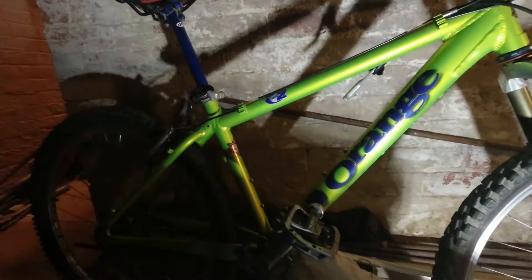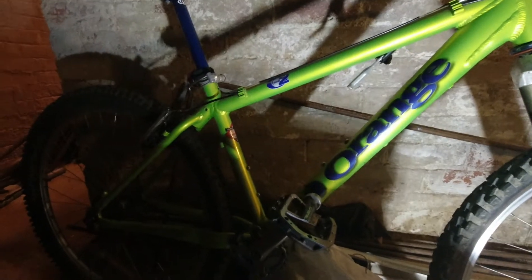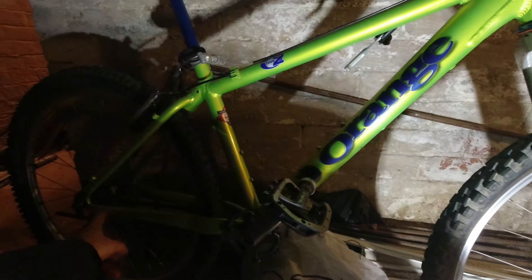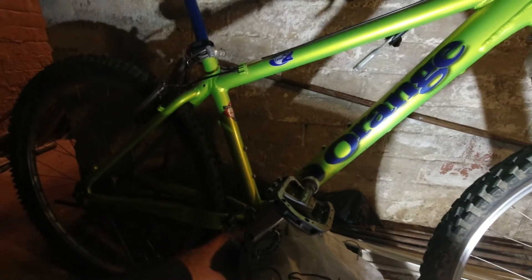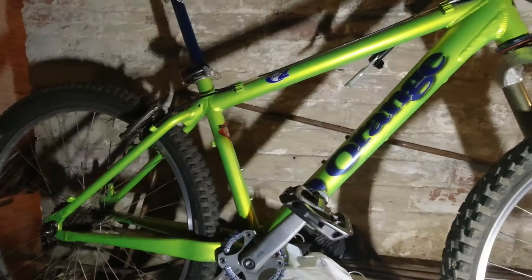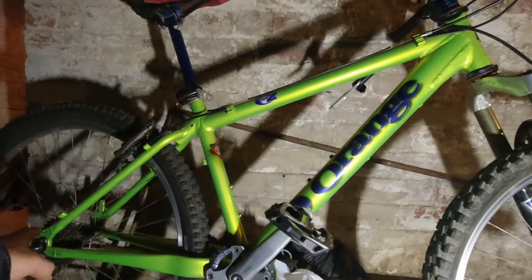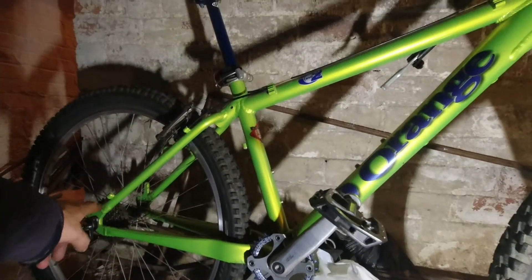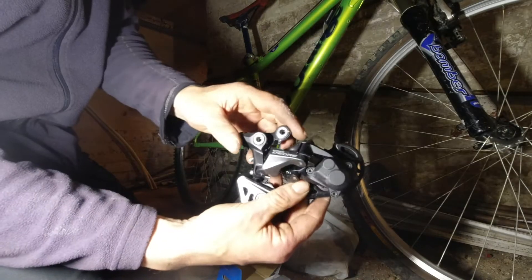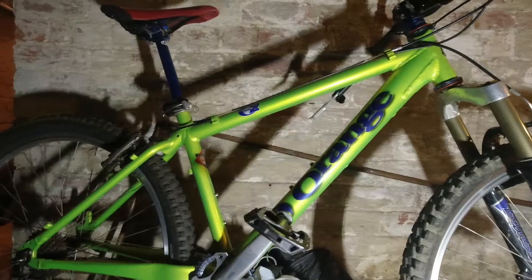Moving on to my bike next - this is a mid-90s bike and I want to upgrade to 11 speed on the back. I've already put a single ring on the front, done that a while ago, love that - it's a Race Face one. So my plan today is to upgrade to 11 speed: change the sprocket, put a new hanger on, new selector at the front, and hopefully that should be it.